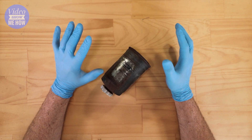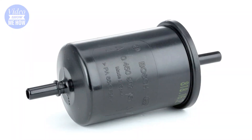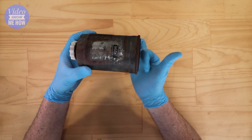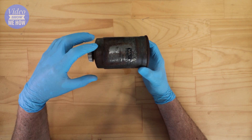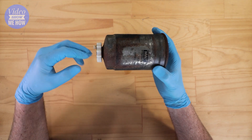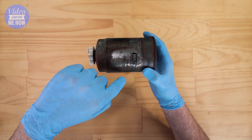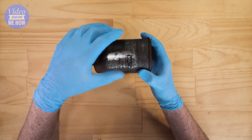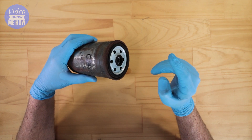Now there are three main types of fuel filters. Obviously you've got your gasoline or petrol fuel filters — they're a little bit different. Normally you have an in and an out, and what happens is on the inside you have a whole bunch of filtration material. Fuel will go in one side, get blocked, and be forced around the outside of the filter, then pushed through the medium and back out the center portion, which is where your nice clean fuel comes from.